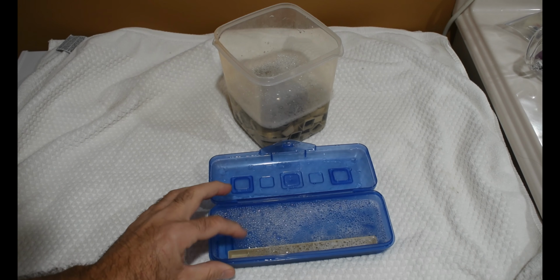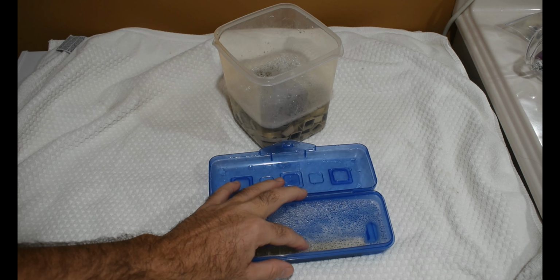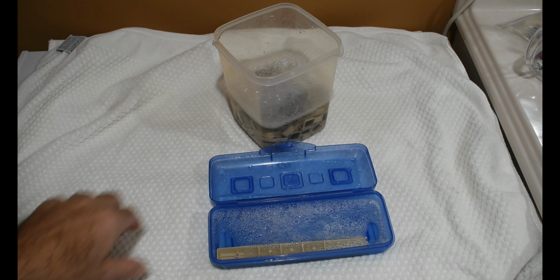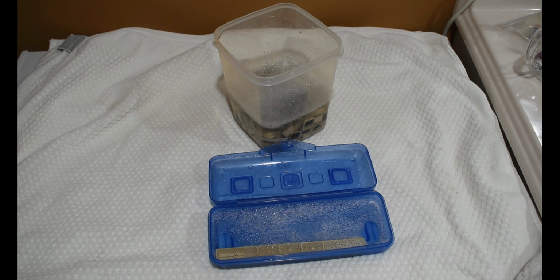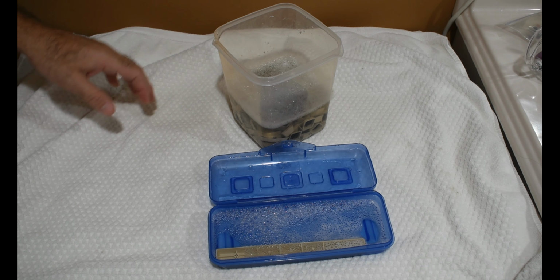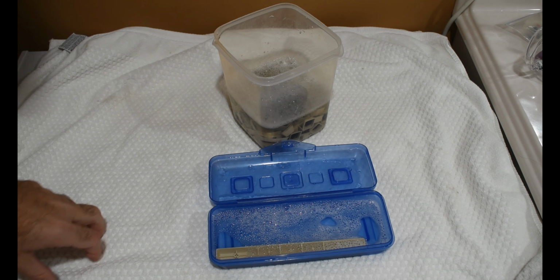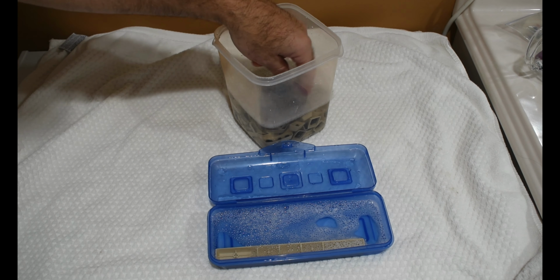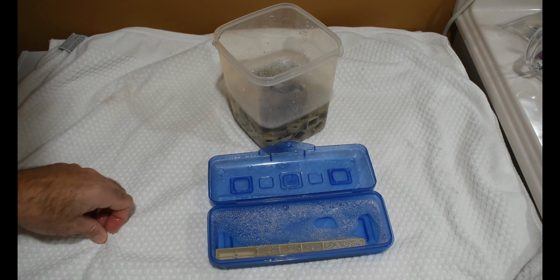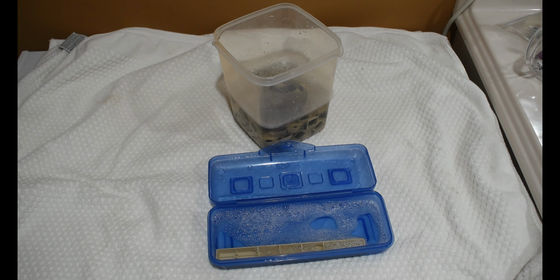So what I'm doing is I'm soaking the keys in a pretty heavy 409 and water solution. The idea is to lift as much dirt off of those keys as possible, and then I'll wipe them down real good, and then we'll get to the retro bright. Definitely don't want to retro bright a key that's dirty, or anything really that's dirty, because then that dirt gets in the way and you'll end up with a very weird result if you were to try that. So this is hot water. I'll let it soak for a couple hours, and then I'll come wipe off each key individually.